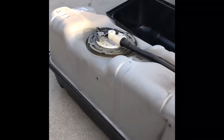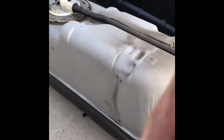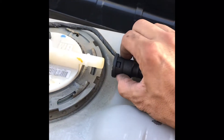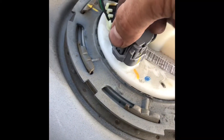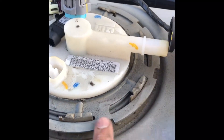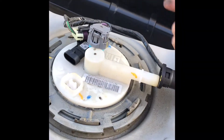Next we're going to work on the lock retaining ring, disconnect the connections, and pull up the fuel pump. To move the connectors, push forward pinching on both sides, then lift the tab up and pull back. For the gray one, just pinch in the front and pull straight up. The locking ring — left is loose — so tap it towards the left evenly, tapping here, here, and so forth all the way around so you don't put all the stress in one single area.